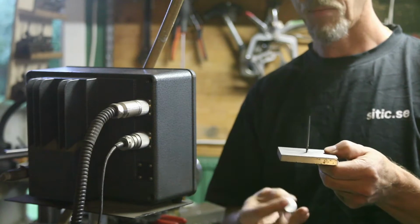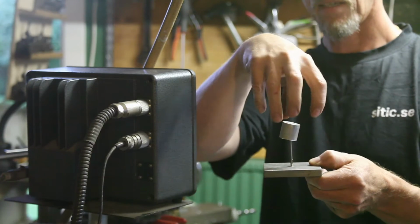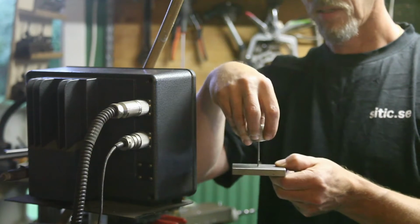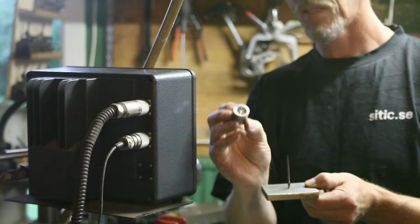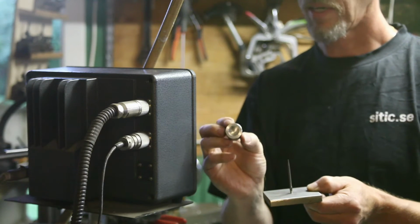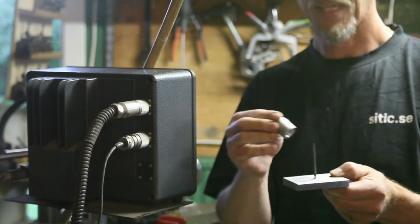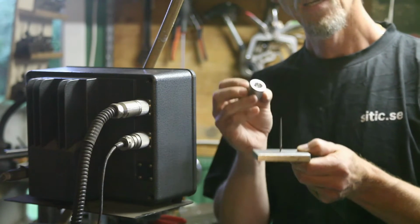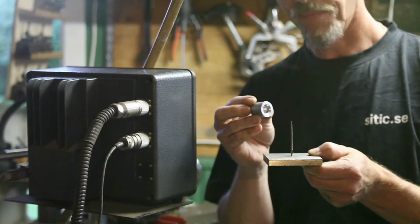So now I have to make something like this that I can put the blades on so that we can make them balance. This was a try I made yesterday before I removed the blades from the lawnmower, and it is too big a hole. I have to make a smaller one. I'll bring it back to the lathe when I find the right tooling.